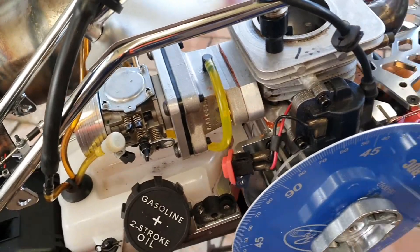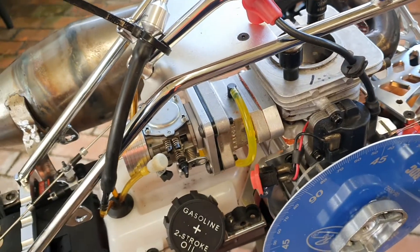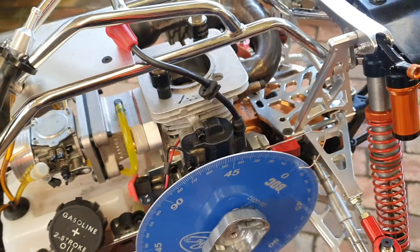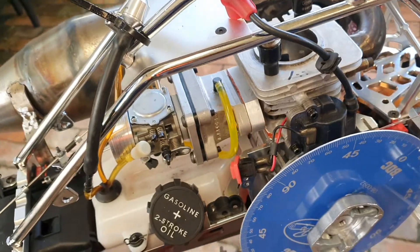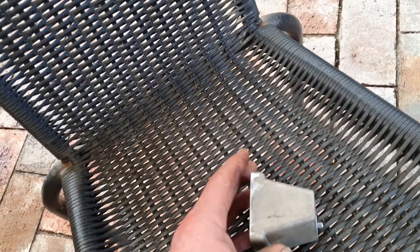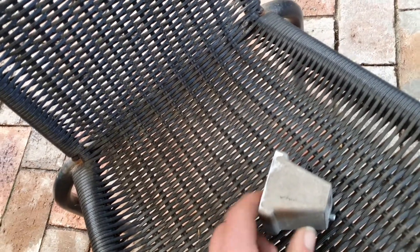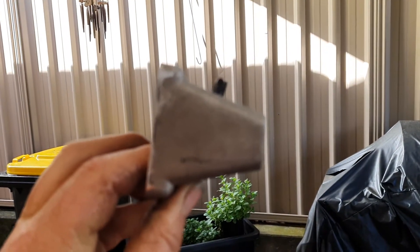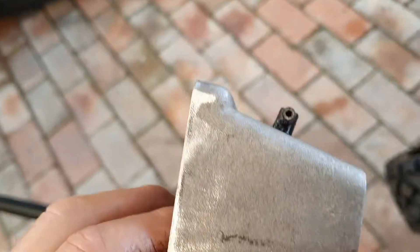If this doesn't solve the problem, it's obviously a blow down issue - too much fuel. It's getting a pressure point in the roof of the transfer ports and it can't blow down enough. Down the bottom of this block here I would have a pool of fuel sitting down there. With the reed block on, it's more of a straighter funnel to the intake.